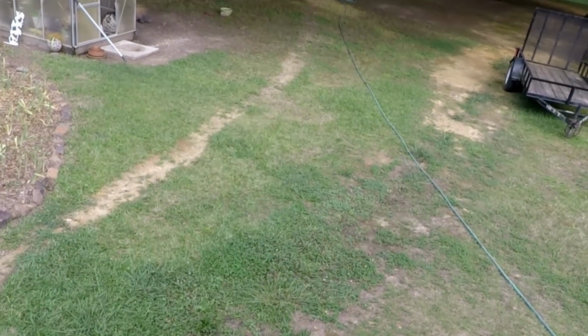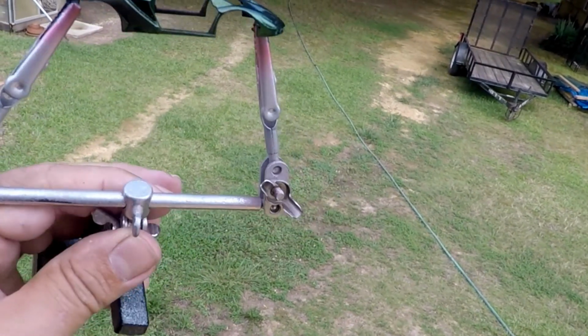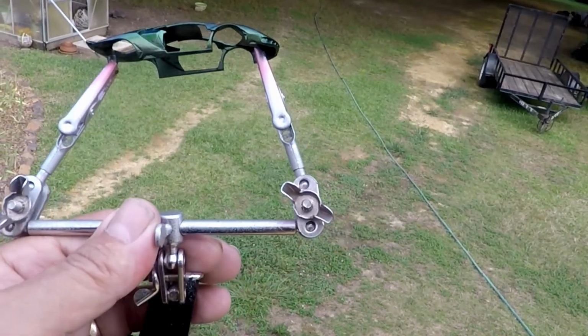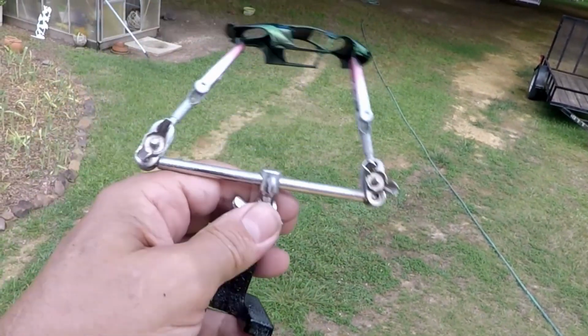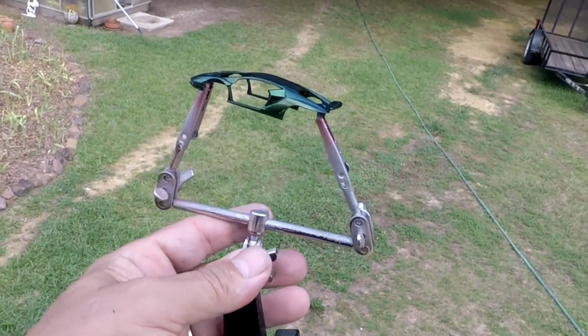Works perfect. 22 to 25 psi. You don't have to thin it. If you want to, you can, but you don't have to. But like I said, all the pigment and everything does settle down on the bottom. I did not thin it, and I had no issues. It didn't really stop up, it just stopped the flow for a second, but like I said, just move it real quick and it started again. No big deal, no big issues.